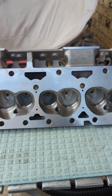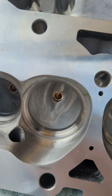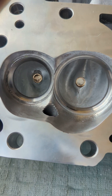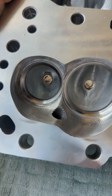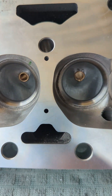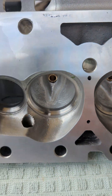I finished these two in two hours this morning. I can't show you the as-cast because the other head I still have to disassemble. I did the chamber too — I polished it a little bit. I still have to do 60 grit on the intake and polish on the exhaust and chamber. These are 2.02 intake / 1.60 exhaust valves, 65cc chambers, and 195cc port volume on a small block Chevy.